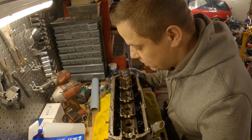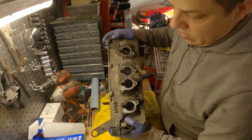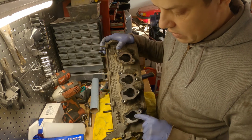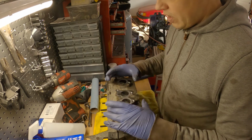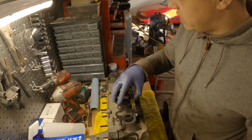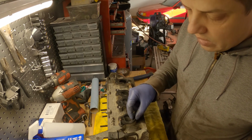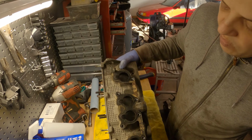Okay, so what we're gonna do is we'll just take a look on the inside. As far as intake porting, I'm not gonna really do a whole lot. I think I'll just do a quick cleanup in here, remove some of the roughness, no polishing. Otherwise, if I was doing a ported lower manifold, which I'll get for you, here is the gasket for this guy. You can pretty much see that everything's already gasket matched on the intake side. Now this is just a soft material, so we could port with the gasket in place, if I wanted to enlarge it. It's pretty much right on the money.